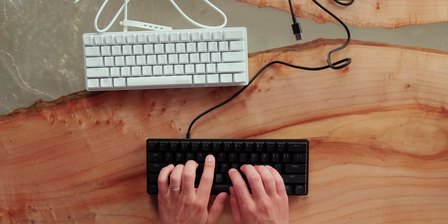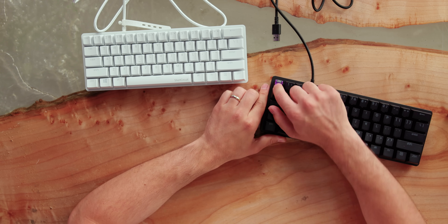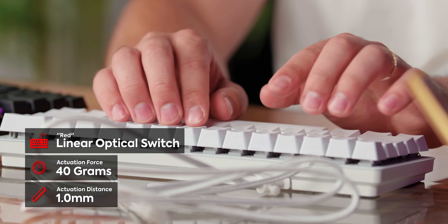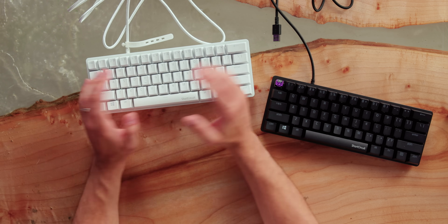How about the feel? These are a lot quieter than previous Huntsman keyboards. They actually made an adjustment to the switch — basically underneath that plus sign you see there, there's a column, a tube, and inside that tube they placed dampeners. They used to have this metallic kind of ping with a roll off on it — when keyboards are like "bang" — they used to have that. It's not so bad anymore. The linear switches require 40 grams of force to actuate — they're linear, so there's no tactile bump. These are optical switches; they say they're a little bit faster and have fewer mechanical moving parts, so they should have higher durability and be more consistent.